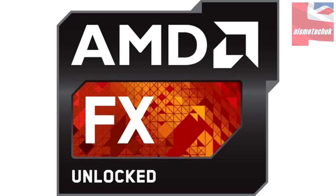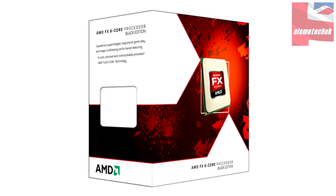On to a little bit more technical information about the AMD CPU. The new FX series processors have been codenamed Vishera, and they feature improved performance and better energy efficiency. The AMD FX 6300 6-core Black Edition is a 3.5GHz processor, designed to run on the AM3 Plus CPU socket. It features 14MB of cache and has a turbo clock speed of 4.1GHz, which is a massive difference from its standard speed. The Black Edition means that overclocking is relatively easy, giving you multiple ways including the base clock or multiplier to get the highest frequency possible, depending on your cooling and overall setup.